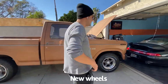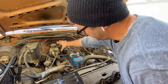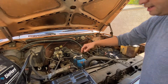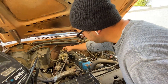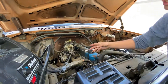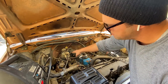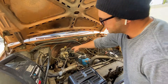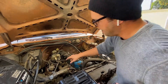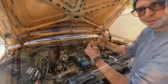Check out the carburetor. It's a mixture of air and fuel — fuel from the tank and air from here. Sometimes you can have cracked vacuum lines. That's what I did: all those guys were completely cracked. So once I closed them, this thing right here — the compression got a lot better. It didn't have air leaks from every hole, so it started sucking from here, and now it makes a perfect air-fuel mixture.